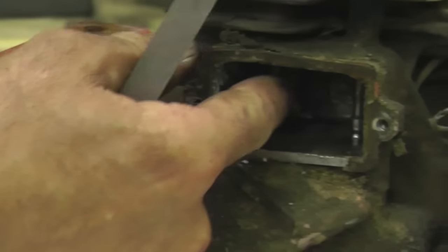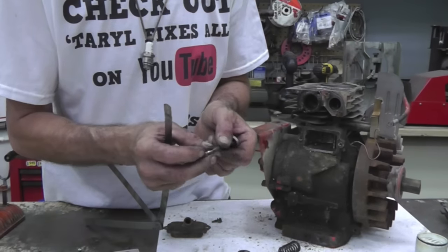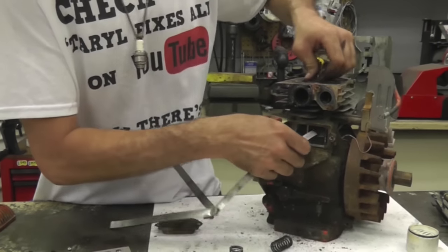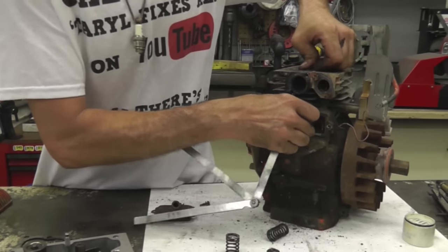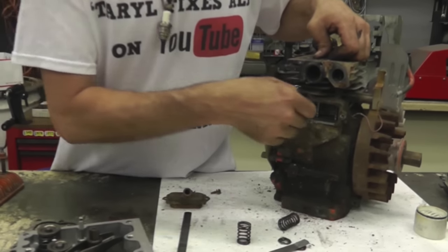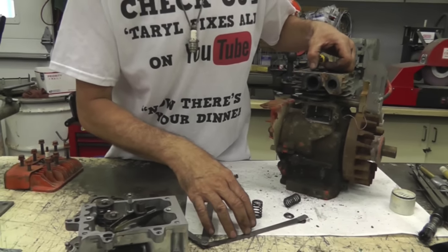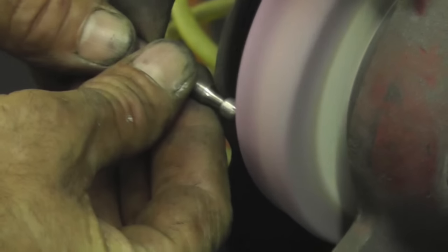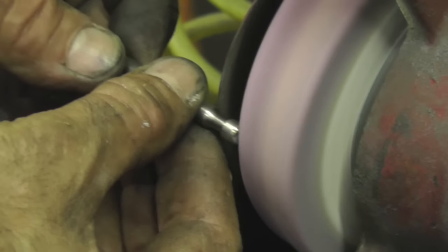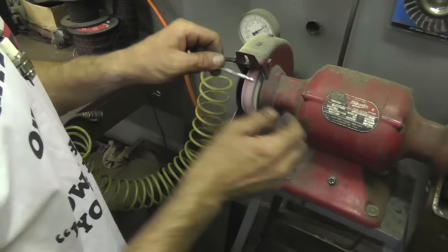This isn't slipping in there. All you do is take it on the bench grinder and spin it on the side of the wheel and just grind a little bit off, then keep checking it — you don't want too much clearance. Another trick: use an 8-thousandths feeler gauge, and when the 8 fits in there loose, chances are you're at 10. Take it on the grinder, lightly, lightly — try to hold it as square as you can, take a little bit off, then go back and try it until you get the right clearance.